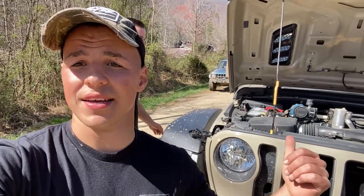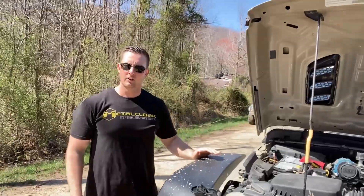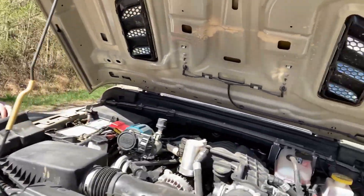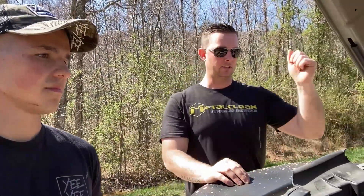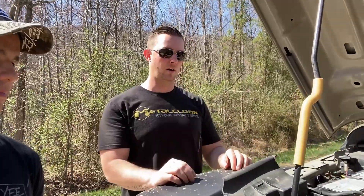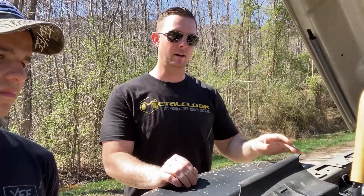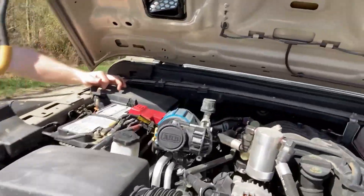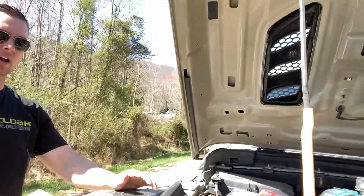One other thing — he has the 3.6 liter, and he's got kind of a unique air compressor setup, so tell us about that. Yeah, so I have the ARB single compressor. It's high output, but it's the single compressor. I installed it right here on one of the brackets where there's a plastic engine cover — the one that says the Pentastar thing on there. I took that off, and there just happened to be a couple holes, made it work, threw some nuts and bolts through it, and it's solid. It hasn't gone anywhere in about a year, and I can air up the tires in probably about 10 minutes. Pretty good for 38s.